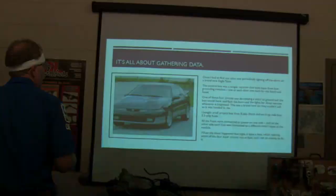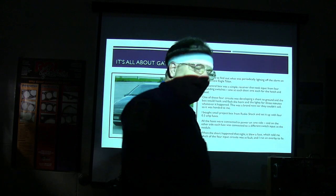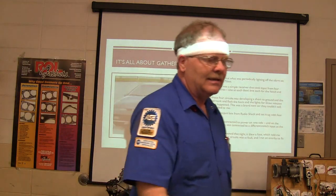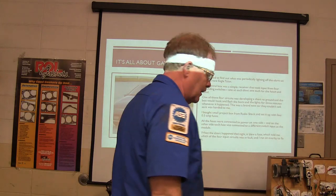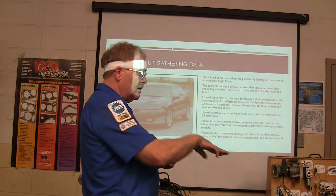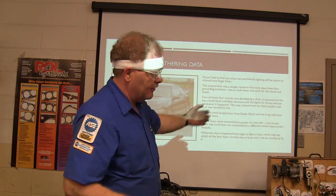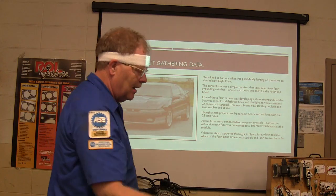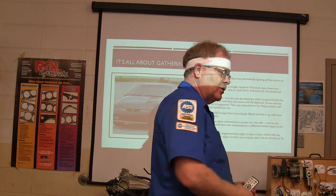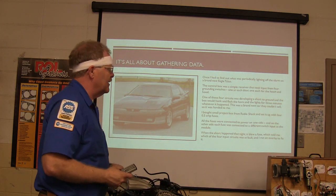I had to go find out what was wrong with this Eagle Talon one time. It was apparently just lighting off the alarm — the control box with a simple receiver took input from four grounding switches: the hood, the hatch, and the door. Every now and then, without warning, it would just start going honk honk honk honk. It didn't have scan tool capability — it was like a '90 model — and they said they couldn't sell the car, brand new. So I built a little project box with four little fuses, about a third of an amp each, hooked into each one of those grounding switches. Left it that night, and whenever it happened it pointed me to the one going out to the hood. I ran an overlay wire and took care of it. I gathered information about which one of the four inputs was the problem, overlaid it, cut the wire I knew was shorted, and ran a new one in a really clean manner so you couldn't even tell I'd fixed it when I got done.